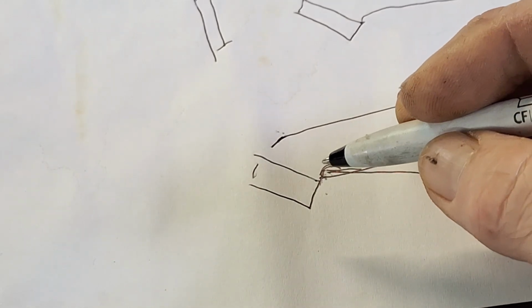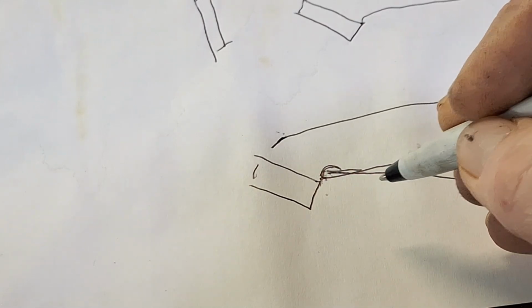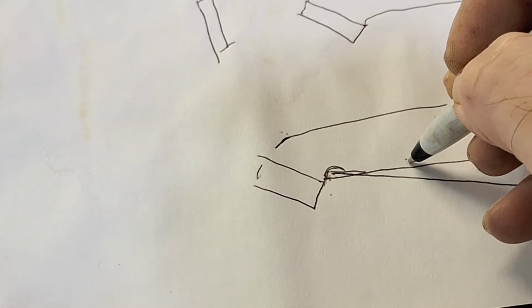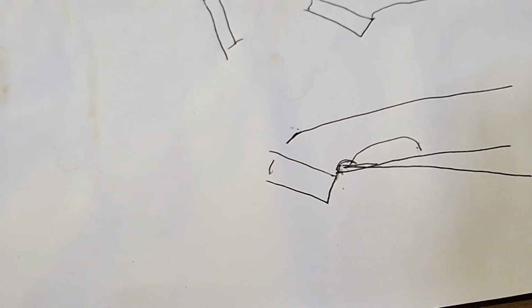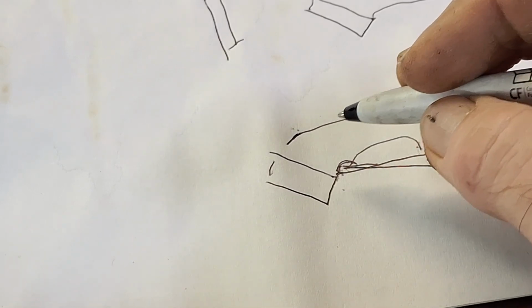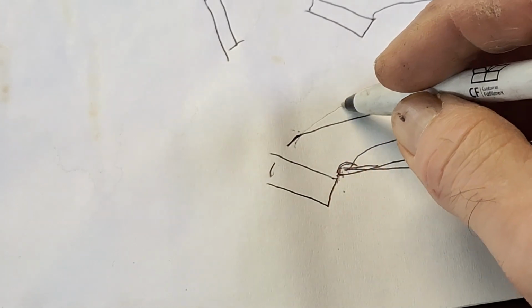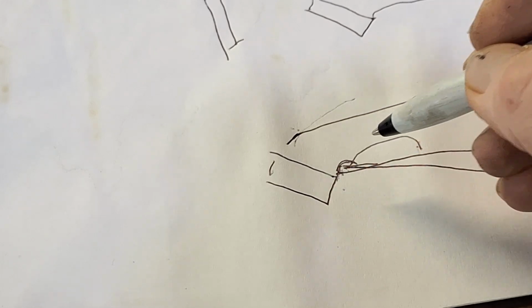And other times I've built up the floor of the port there, given it a little more hump right there with some Marine-Tex or something like that to give it a little help. Then, where this bend is right here, take some material out to open it up so it flows a little bit better.